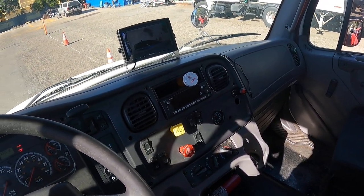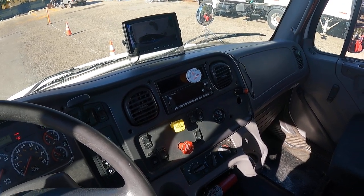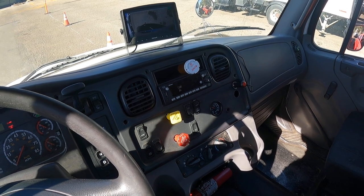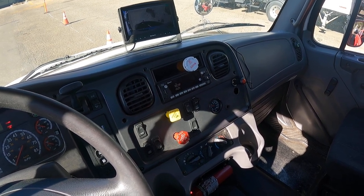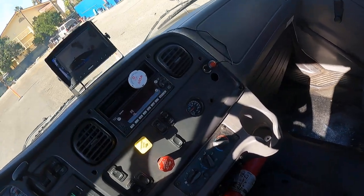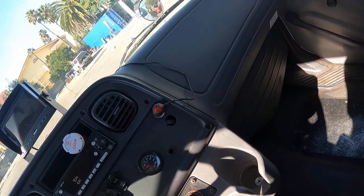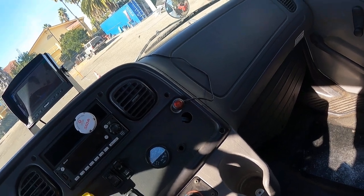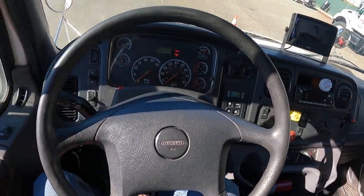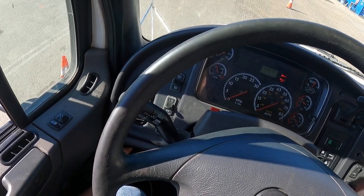They might pop out together, they might pop out at separate times, in which case you would give 2 separate PSI readings. Okay, they popped out together at 35 PSI. This test is good. Now we're gonna start the truck back up.